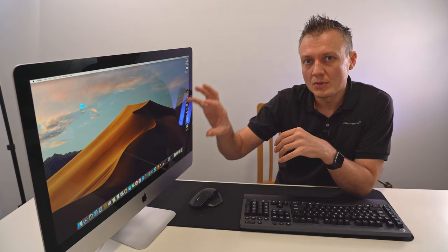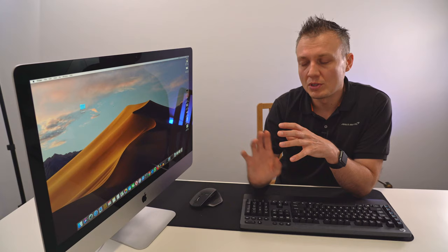Not so fast. Okay, let me explain. I've realized a few things while doing this project. First of all, the internal Fusion drive, it's not actually part of the drive itself, as I firstly thought, as for example FireCuda is. It's an actual drive SSD PCI Express drive on the motherboard itself. So that's what accelerates the spin drive.